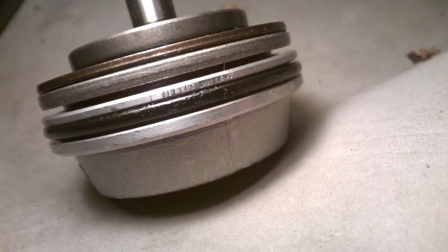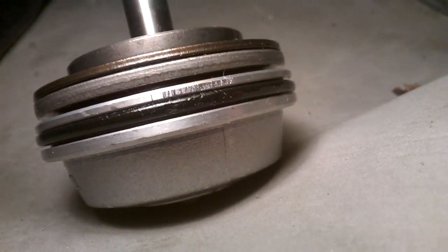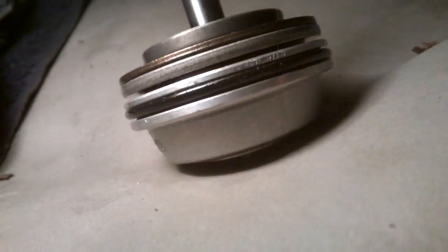Just make sure you have a snap ring remover tool or something like that. I noticed some roughness on the piston — right on this spot, the piston is rough. You can also see the rubber seal seems a little cut and damaged right at that spot. The rest of it is okay, but just at that place it's rough, and that part was sitting at the bottom of the piston.